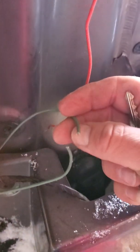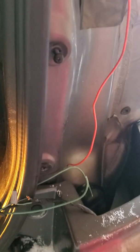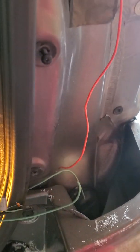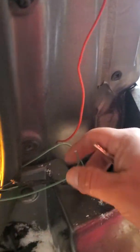What I did was I cut the green wire to that trailer hitch, which I don't need because I don't have a trailer hitch, so I don't need the trailer lights. I cut it and it went back to normal. I think it was just shorted out there and what it was doing was completing the circuit, making the light come on. I just ended up cutting that and everything seemed to go back to normal.